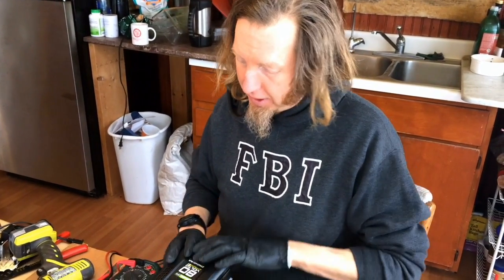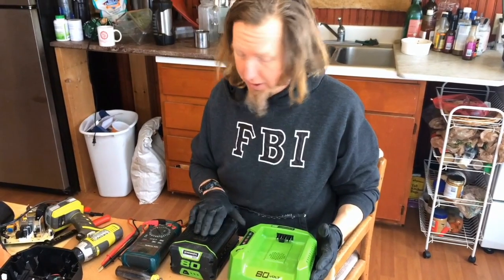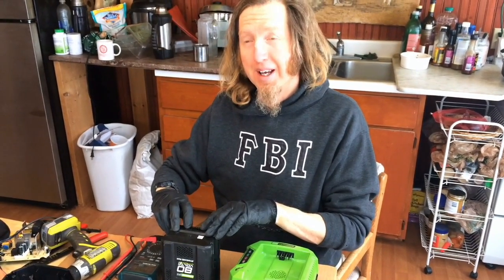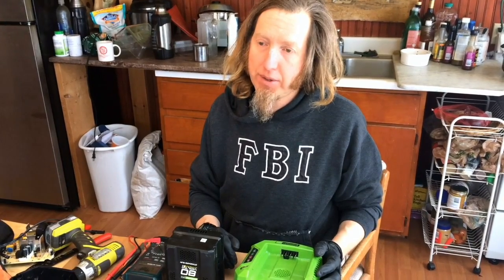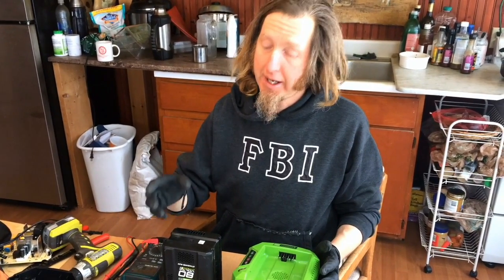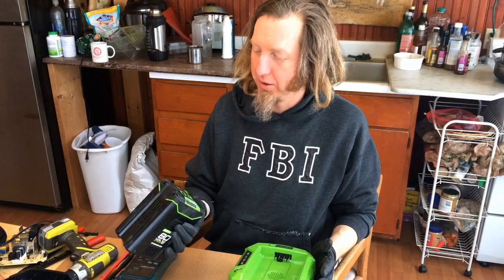You can use this, and it's definitely the way to get the most power out of it. It might actually work with 82 volts — I don't usually run 80-volt packs, so this is new to me. If someone was doing this from scratch, you'd recommend they go with the 56-volt? I really like the 56-volt packs, because 52 volts is about the voltage that doesn't conduct through dry skin. That's why most e-bikes are between 48 and 52 volts — you can touch the electrical contacts with your skin and not get shocked. When you start getting up to 80 volts, that's not the case. I'm using nitrile gloves here, which you should always do when working with electronics. If I stuck my tongue in this battery, it would not be good — potentially it could kill me.